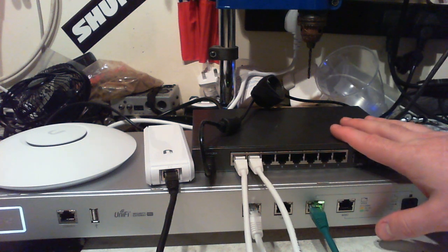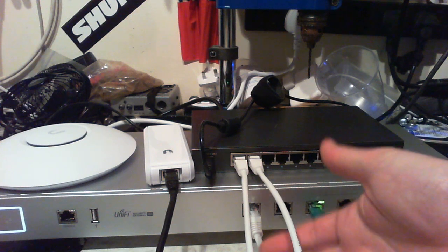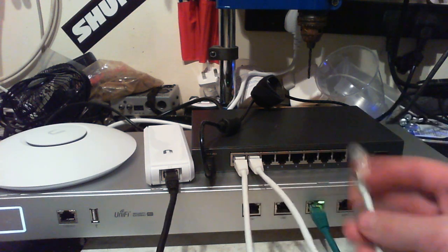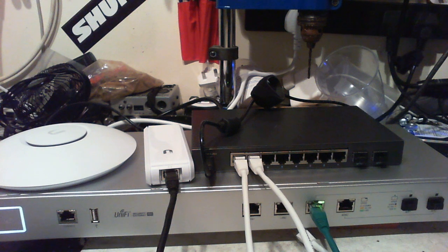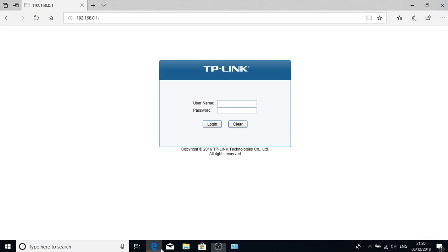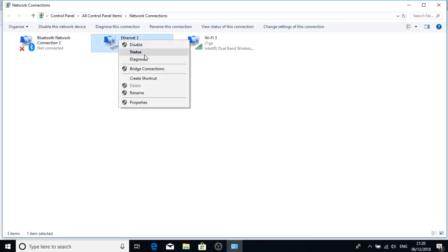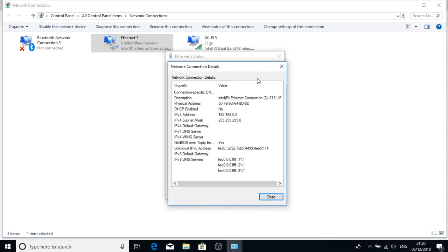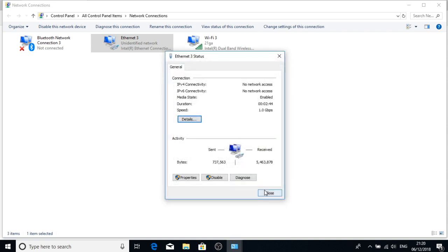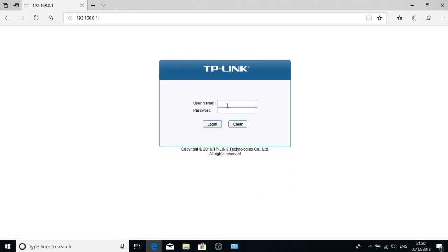You've got two LAN ports but we're only going to use one. I'm currently connected to the switch on a laptop and everything here is at factory default. I'm not plugged into the LAN yet. I've already set myself up with a static IP because we need to reconfigure the TP-Link switch first, so that when we launch everything else it will be in the correct range.